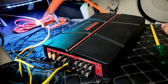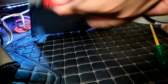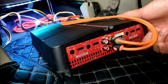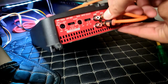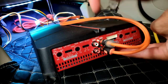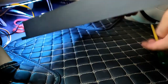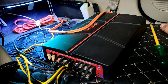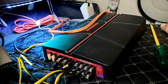If you plan to run all four speakers or both channels, you'll need to install another RCA lead. Basically, one RCA lead represents one channel, so if you're going to use all four channels you need two RCA leads connected to the amplifier. Since I've not connected any speakers here — just the subwoofer — I have both channels dedicated to the subwoofer only.